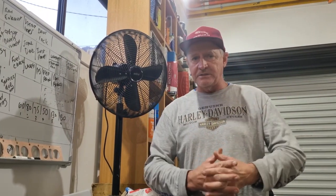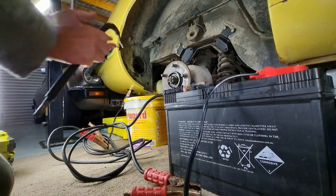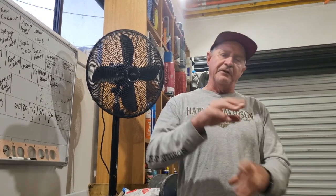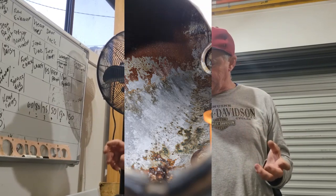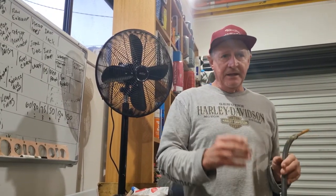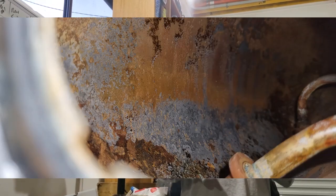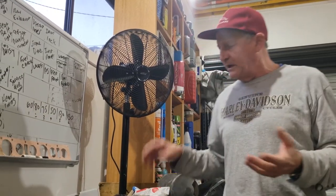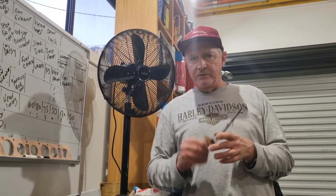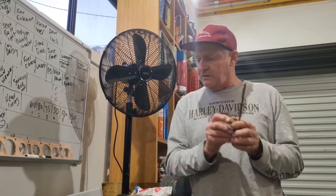As you know from my last episode, I was doing a bit more electrolysis on Miss Daisy — those tanks are just as bad as the satin beige old girl was. I did a bit of electrolysis with the solution; I was only able to fill it up one third of the tank because the sender unit — I can't get the electrode into the top of the tank. So I had to put the electrode into the sender unit down below, and it cleaned pretty well. That lower third of the tank is looking pretty good, but the upper part of the tank is still pretty bad. A subscriber recommended that maybe I use an old fuel sender unit — I seem to have a few of them — and make an electrode out of that, so I thought that's a good idea.